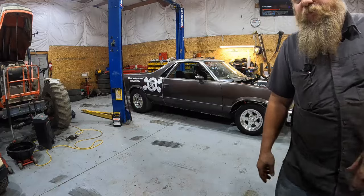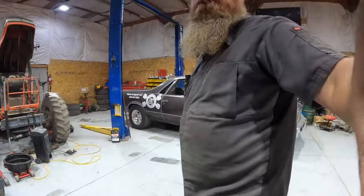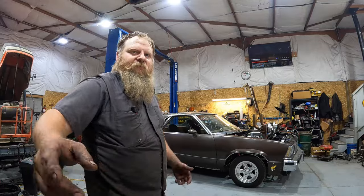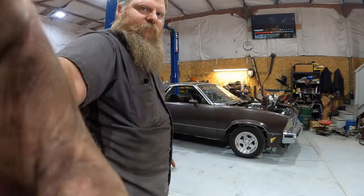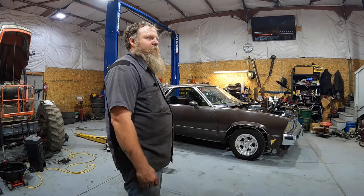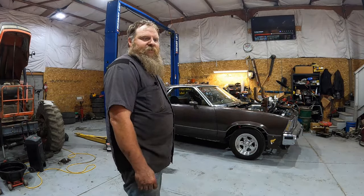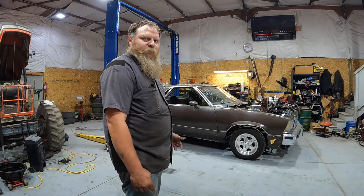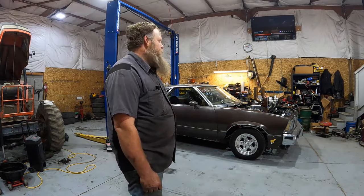It doesn't feel any looser. That torque converter doesn't feel any looser than the other one. But it's supposed to be. That's what its specs say, is it's a 3200 to 3500, and it's coming in just as early as the 22 to 2400. I don't know what's going on.